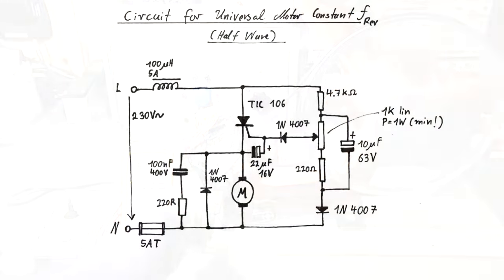Let's make an additional observation. I now shut down the current through the field coils completely — zero amperes — while keeping a voltage across the armature, and as you can see the motor is still spinning and even speeds up. But I can now very easily just grab the shaft and stop the rotation because there's almost no torque. Why does that happen? We'll hopefully understand it later in this video. But to make that happen, it's time to learn a little more about the field coils themselves — why are they even there?